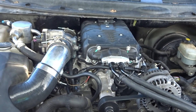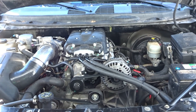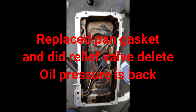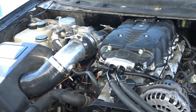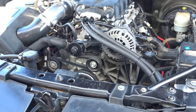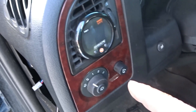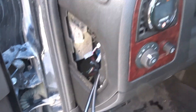Update — we have finally been driving this thing around. I still need to clean up some wiring. The whole issue has been the oil pressure. I had an oil pan gasket leak, so I pulled the pan, deleted the relief valve in the pan, and did a new pan gasket. I also changed the oil pump again to a new Melling — I think it's the 10295 HV. So far I've been cruising around at about 40 psi and it will get down to 18 idling, but that's plenty fine. I'm also working on the tune with my tuner, and I just sent my air vents off to have a gauge insert installed so I can wire up the boost and wideband gauges.